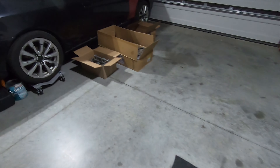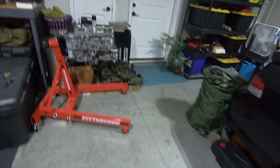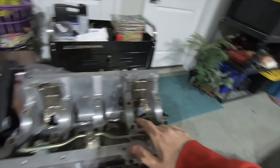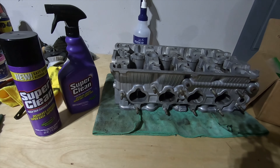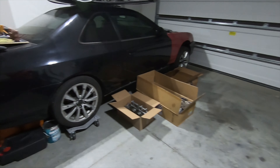I'm going to put that box under the car with all the other cleaned components and get ready for a later date when I start rebuilding this engine. I'm in no rush — I'm going to take the block and head down to the machine shop, have them check for cracks and surface both so they mate up nice and even, then bring them back and start rebuilding. In the next video I'm going to hit everything with the POR-15 black and the Rust Bullet gray and get that hardened up and ready for install. If you want to see more content, make sure you like, share, and subscribe, and I'll see you on the next one.